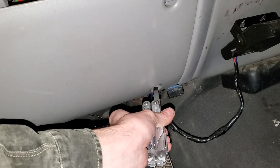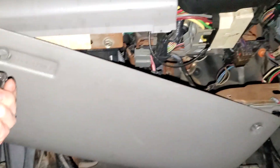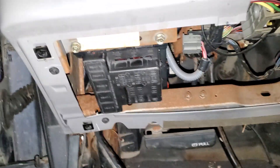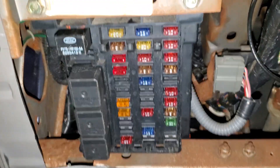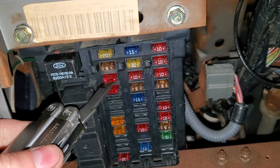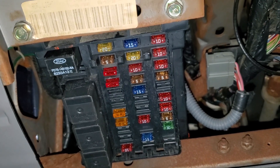You just remove it by rotating all these little pins counterclockwise and this piece will just come right out. The cover is right here — you can just grab it and pull it towards you gently. It's going to be fuse number three, which is located right here. This truck has a 10 amp fuse installed there, which is the wrong amperage — you can install up to a 20 amp fuse.